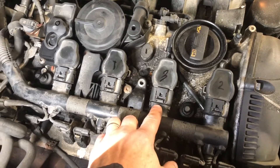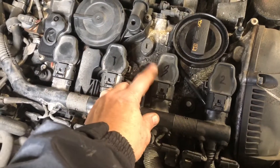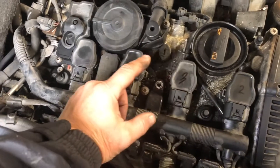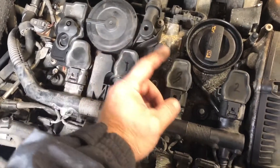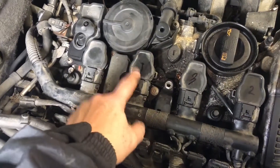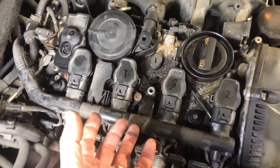So think about that for a moment. Then I moved just the coil — not the plug — just the coil from cylinder two to cylinder three. And then moved the coil from cylinder three back to cylinder two. Started up, and the misfire is now in cylinder number three. So given that information, what do you think this vehicle needs to fix it?